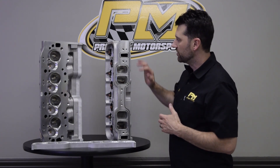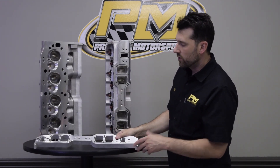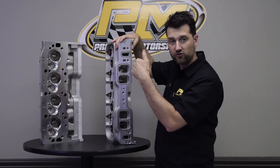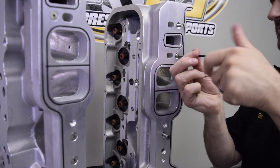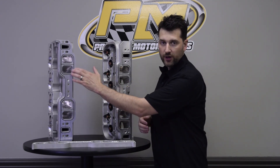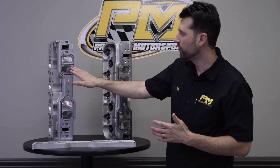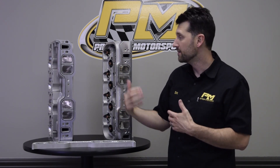What we elected to do was machine o-ring grooves in both the cylinder head and this custom spacer plate. With the o-ring between the cylinder head flange and the spacer plate, this plate actually bolts on straight — the bolts are not at an angle — so the accuracy of lining up this spacer plate with the intake port is very precise. The key with the o-ring is you get repeatability as far as the position of the intake manifold once the fasteners are torqued. With a paper gasket, every time you compress it, it's going to change position slightly. With the o-ring you're coming down metal to metal, and the o-ring is just being squished in between the two metal pieces, so it's a lot more precise and a more positive seal.